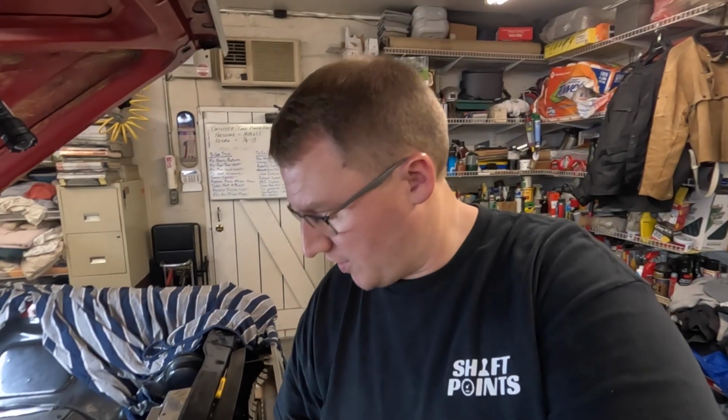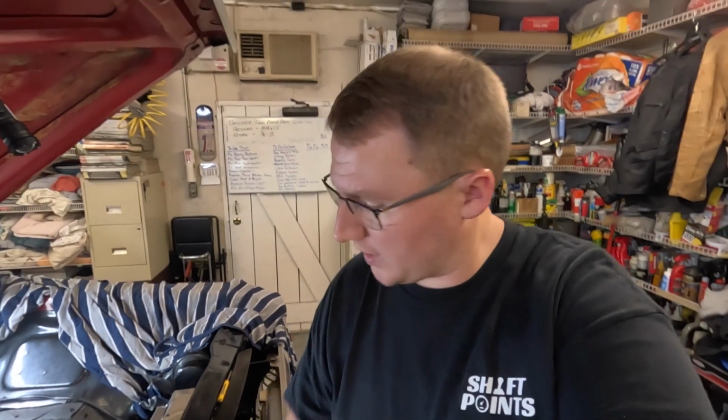While Dad works on that radiator mount a little bit, we've been mocking it up and figuring out what we need with this. I decided to go ahead and start working on wiring up this distributor. So that distributor is going to have to come back out. There's no extra ports in this intake manifold to let us put the fan switch that came with our electric fans in the intake so that we can get accurate temperature.